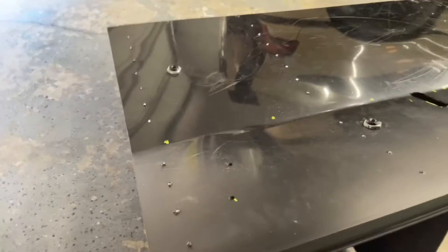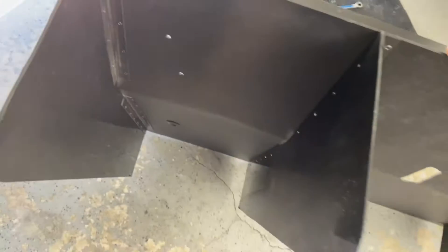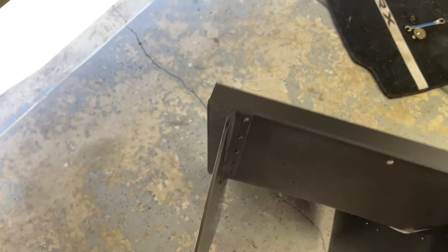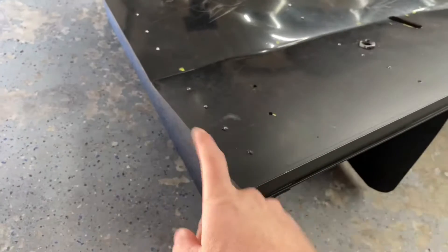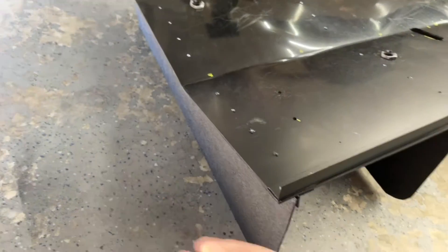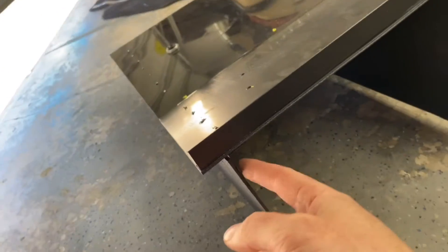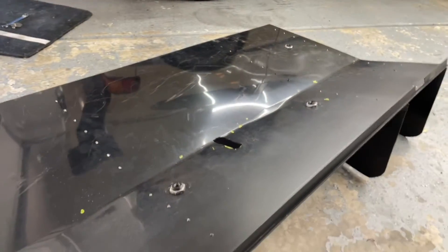What made it a little more difficult was as I cut my fins, I essentially used L angle and attached it that way. There are definitely some better ways I could have done this. If I had something big enough, I could have just made this end bend over, but I knew I wouldn't be able to do a good enough job with it. So either way, eighth-inch ABS and eighth-inch aluminum L angle, rivets shot through it — I made a rivet pattern for it.